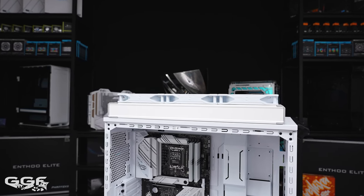I painted all of the black bits in aluminum color — it matches very well with the EK Satin Titanium, contrasting much better than the original black parts. I used the new EK white water block for the GPU — they currently only do it for Strix — and the Socket 1700 CPU block, both with a nice satin silver titanium backplate. The tubing is Thermaltake P1000 in Marble Blue, which contrasts really well. I really like blue coolants in any shade. That pops nicely against the pinkish RGB for the lighting, memory, and SSDs.